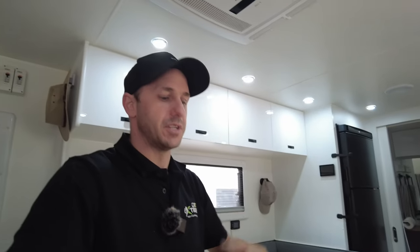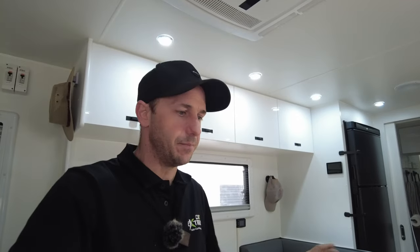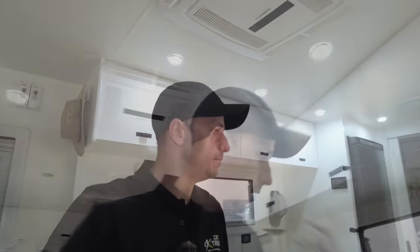If someone needs to pull the batteries out, they don't have to worry about diving into the system and shutting things down technically like that. They've just got to grab a switch and pull it. You can even remove the dial on that switch too, so it's almost a lockout, which would be another really good point if you were to, say, store your van at home in a shed somewhere and you wanted to disable those batteries completely from the system and have them just sitting there. Of course, you still need to make sure they maintain their state of charge, which you can see on the top of Paul's batteries. He's got his little gauge. So if you wanted to look at that as a guide of where they're roughly sitting, you could. It's up to you guys, whatever you do with that.